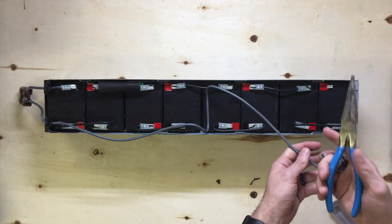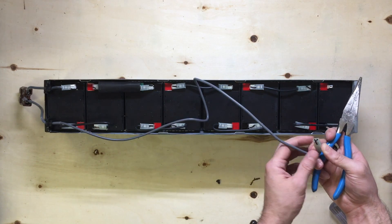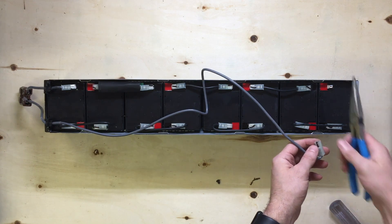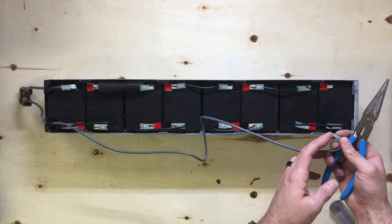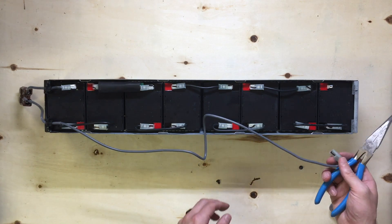The reason I like the needle nose pliers is because there is actually a little bit of a latch in here. So if you squeeze it right here, it releases that latch and makes it a lot easier to pull off the terminals of the battery. It'll actually keep it intact much better than straining to pull it off. So when you put your replacement batteries in, they'll fit nice and snug for you.